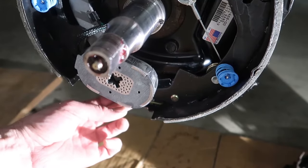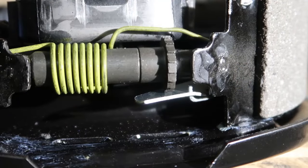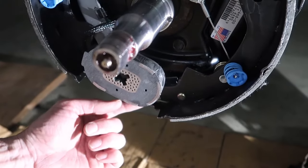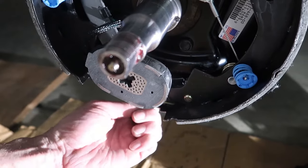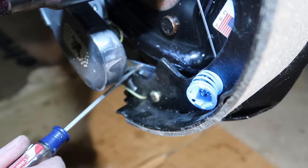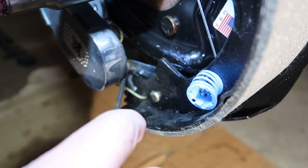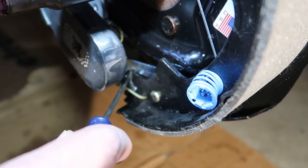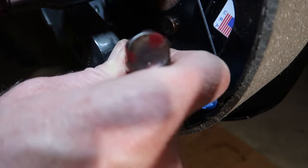This adjuster star wheel is arranged in such a way that it's got little notches or ratchets on it, where this arm will catch on the teeth and cause it to rotate. Look real close — here's that arm right there, and here is the little star wheel. It has teeth on it; the arm engages on the star wheel teeth and causes it to rotate only one direction. There's sort of a little ramp that leads up to each tooth.